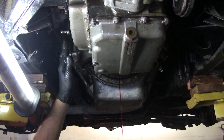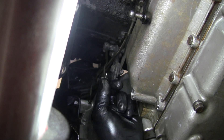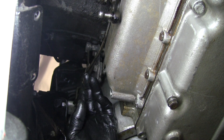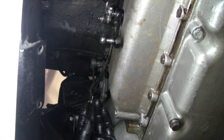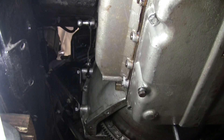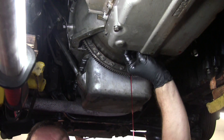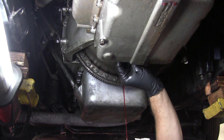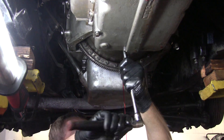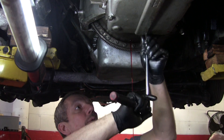If you can get your camera up there — this is the throttle valve linkage. This hooks up to the gas pedal, and you can see there's a bunch of play in it. He's getting like a quarter throttle before it even starts to move this thing back here. Is that play because of wear? Yeah, usually. That's your throttle valve — that's the part of the control valve that tells it how much load you have on the engine. How would you remove that play? You would have to take the linkage apart and re-bush it, or engineer something to take that play out. I'm going to fix that before I'm done with it, that's for sure.